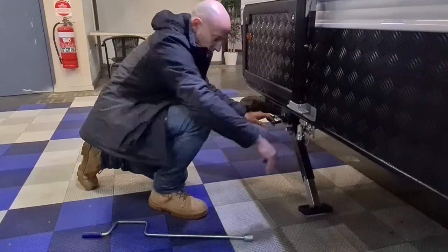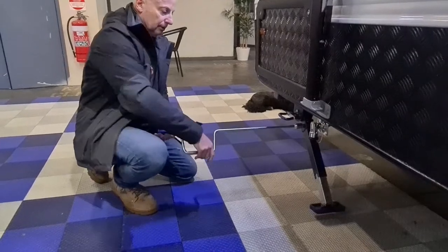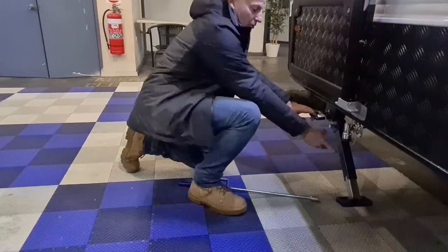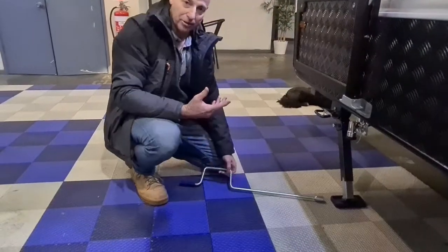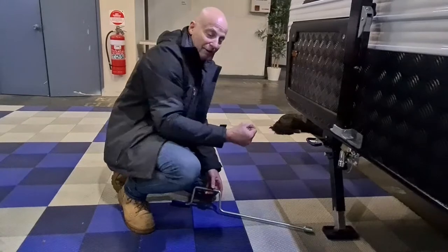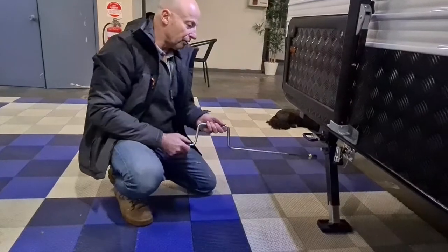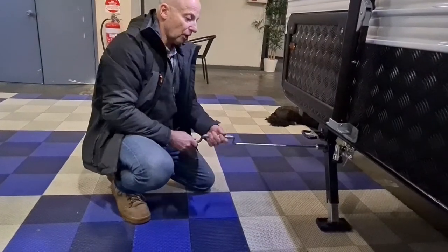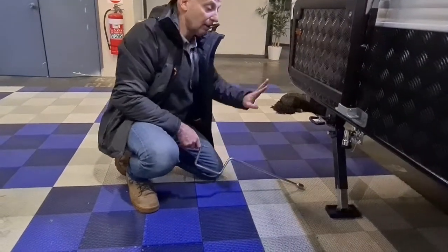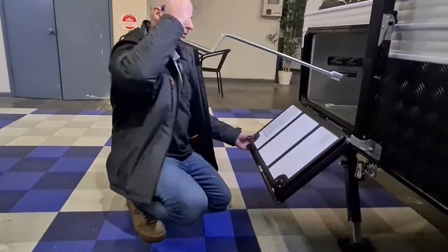You can use a drill for winding the legs, which is not a bad thing to do. But I would strongly recommend against using an impact driver — the problem with impact drivers is you put them on here and you can't feel how much torque it's putting onto the fitting, and it ends up breaking the gears. So really, don't use an impact driver. If you want to use a drill, that's all good — just don't overdo it. So just like that, with pressure on it the caravan's now stable — that's exactly how I want it.